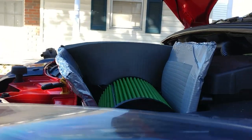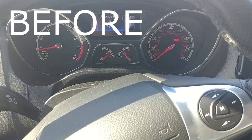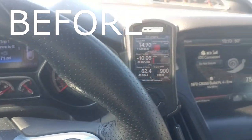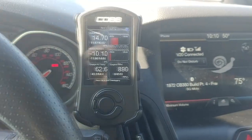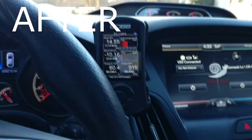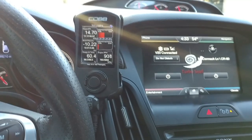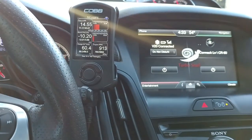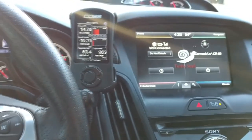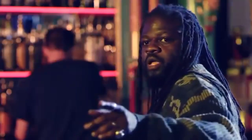Sounds pretty good too. Here you can see how our cold air intake seals when the hood shuts. Fully warmed up — old temperature up — 12 degrees above ambient. We're back warmed up again. The old setup was a little bit hotter this time, but we've only got a 6.4 degree difference between ambient and charge air temperature. It was so stupid it had to work. Those were both taken after sitting at idle for one minute — so colder temperatures, more power. It's so damn frosty, people will be like, damn, that's a cold-ass intake.